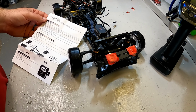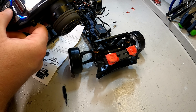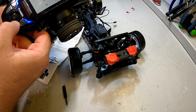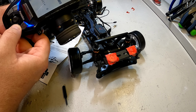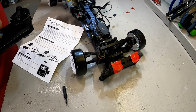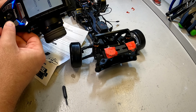All right, endpoints are set. I've got the AVCS set, and it does appear that through my channel 3 setting on my controller, I am actually setting the gyro gain. So I'm going to turn it off. I'm going to go to 0, and I'm going to see, yes, gyro is no longer working. So I'm going to crank that bad boy back. I'm going to see what happens if I go positive or negative.